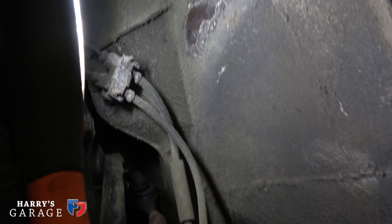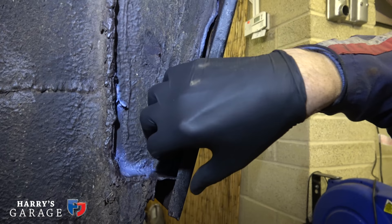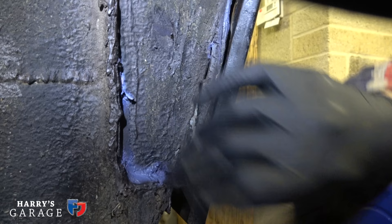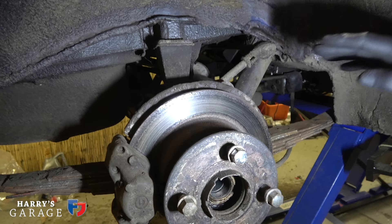I'll show you a horror on the other side in the other wheel arch. This one's similar — there are patches that have appeared and a lot of treatment needed on the inner arch. I was scraping away and this came away revealing how they'd actually done the repair. I can't get over it — that is bare, untreated metal: an inner arch and a new wing with no treatment whatsoever. They just covered it with a bit of rubber thinking that'll seal it — no wonder it was all going rusty. This was done in 2002, and as you'd imagine it's all starting to rust, but I've caught it fairly early so I think we're going to be all right.